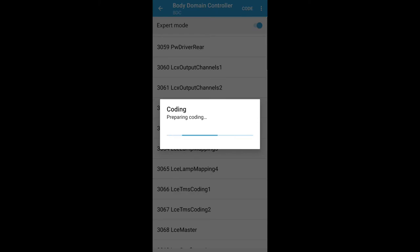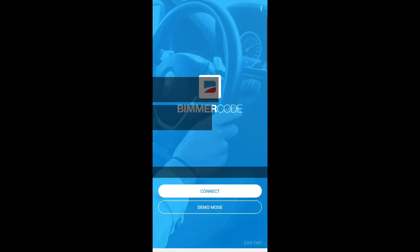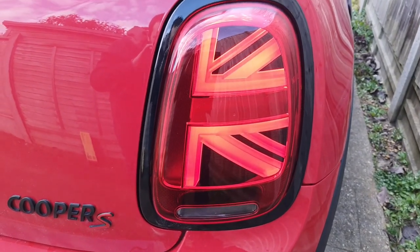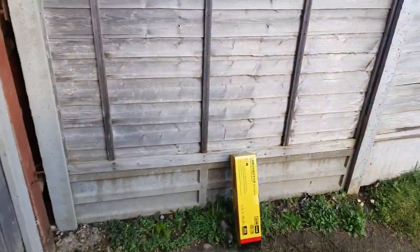Click OK, then go out and click Code, then Start Coding, and hopefully nothing will go wrong. It says 'writing code data' — it should be quite quick. Then it'll finish coding and restart the ECU in the car — you'll hear bongs, it'll start doing stuff with the aircon, and then it's done. Disconnect, then go and check the back of the car lights. With your side lights turned on, the Union Jack part lights up — it's only flickering in this video because of the camera refresh rate, but in real life it's not flickering at all. Then we'll try the brake lights.